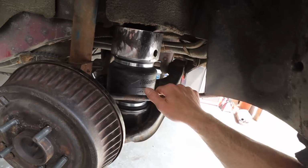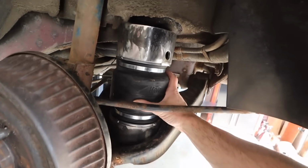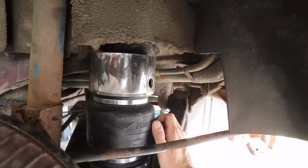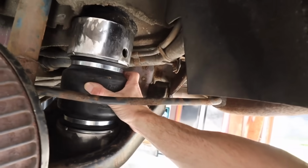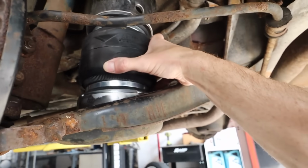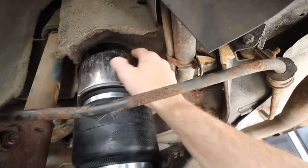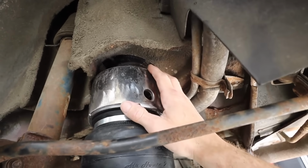Well, we've got the first rear setup in, and already I am super stoked on this design. Using the 5.5-inch outer diameter pipe was the move because it's the same diameter as the spring, so everything fits in super tight already. It's in this bottom cup of this control arm as tight as the spring normally would sit. And up in here, we have yet to put the rubber upper piece on, but that'll help tighten that up and keep it from being loud.